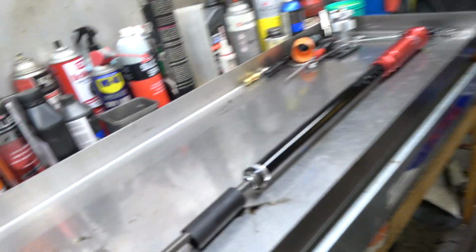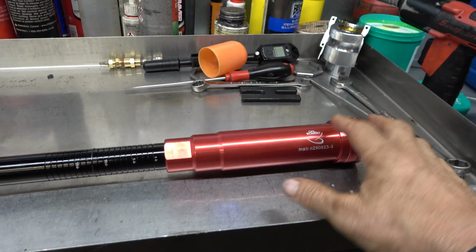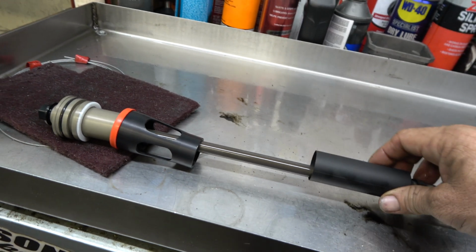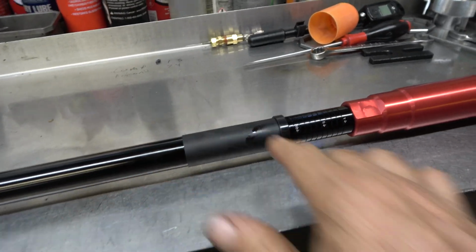All right, guys, let's start with taking a look at the Dal Soggio Sphere insert. Here it is. It is a classic closed cartridge insert. We've got a compression valve up here. We've got a mid-speed valve that rides up and down in here. Pretty cool.